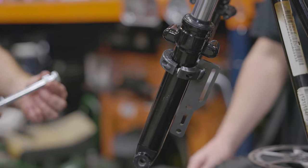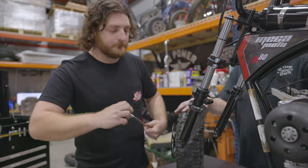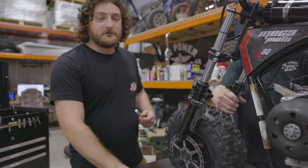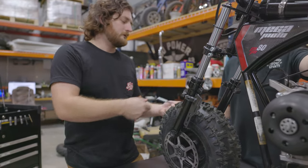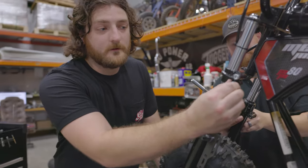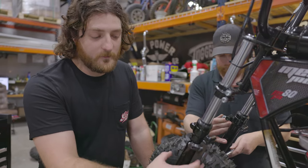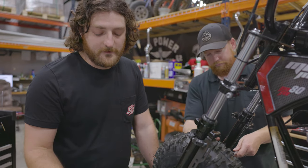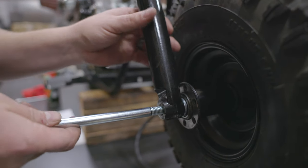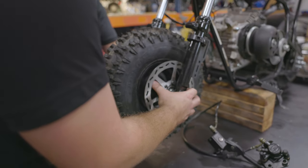Let's go ahead and get the tire on. We've got seven spacers or washers. Five of them are going to go on the side with the brake disc, two of them are going to go on the other side. Now, as we were taking this apart, Taylor loosened this up. If you loosen that up, it makes it a lot easier to pull the axle out so you can get all of the spacers in on this side. Two spacers — this is on the non-disc brake side.